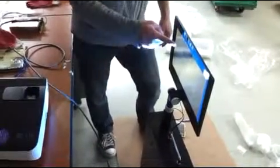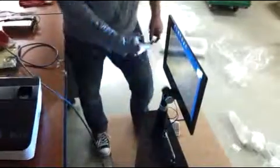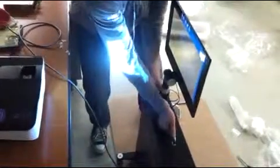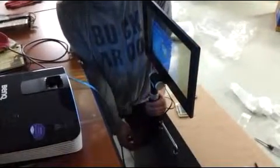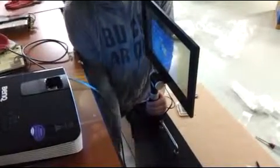If you look at the screen here, the projected image is not inside the filter. It's actually outside. So you gotta make it fit. It's too far from the projector, so you want to bring it in like that. And you can see that it's actually in there. Most of the adjustments you want to make, the small adjustments, you want to do it using the 3D filter height adjustment, not the body adjustment.